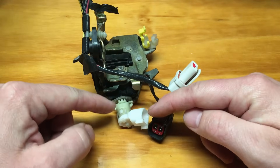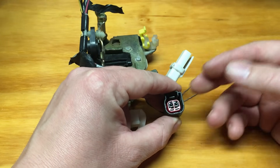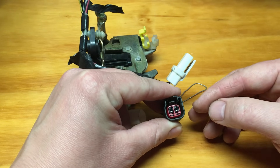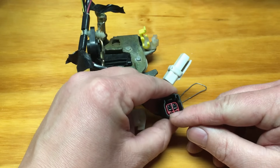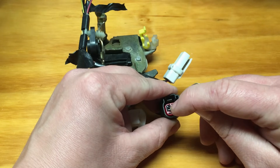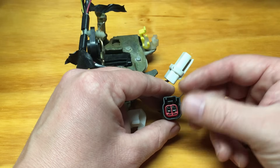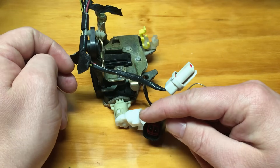If your modules are still not responding after jumpering, make sure one of these two pins has a constant ground — it should always have a constant ground. If it does, one side is good, then concentrate on the output side. Get a ground from your battery, jumper it over to the output to the module, and if it still doesn't work you need to go further in-depth testing with the A-pillar accordion harness and the module itself. But 99% of the time the problem is right here at the switch.